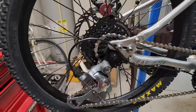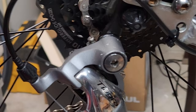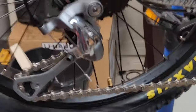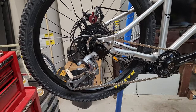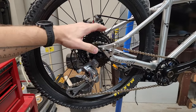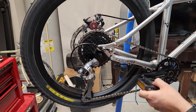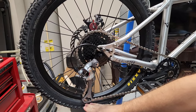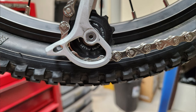One thing I wanted to mention about the rear derailleur - I tried to use an XT derailleur which I thought would be more mountain-bikey, but the problem is when you're in the biggest rear cog, even with the current derailleur the bottom is getting very close to the ground. On the XT it was even closer by about half an inch, so I decided that was going to be unacceptable.